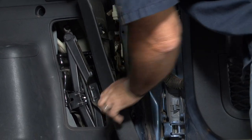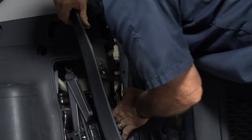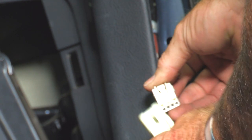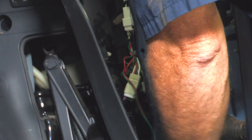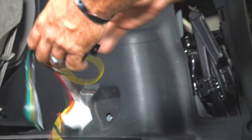I'm just going to pry away a little bit and show you all of our connectors here. There are quite a few, so we want to find the one going into the tail light harness that matches our tow connector harness. Just like that — I'm going to take the tow harness connector and plug it in. We have the other end that's going to go into the vehicle, and it clips right in. Now we'll go ahead and route our wire over to the driver's side.